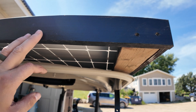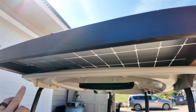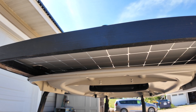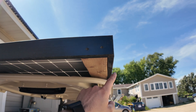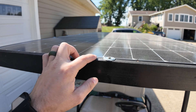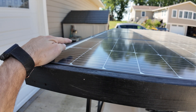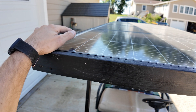The rack system that we built here is a pretty simple design. We just have a two by four that runs along here and also over here, and then we put a couple of screws from the bottom side into the two by four to hold it. The two by four just has a one by three that runs all the way around the perimeter of the frame to hold the solar panels in place. On top we use some wood screws with a big fender washer to hold the panels down. We did one at every corner so that one screw holds down two panels each.